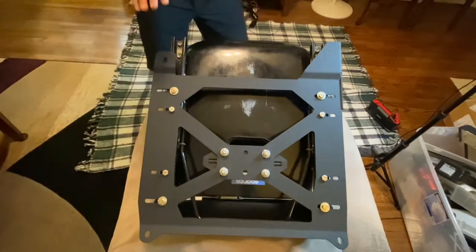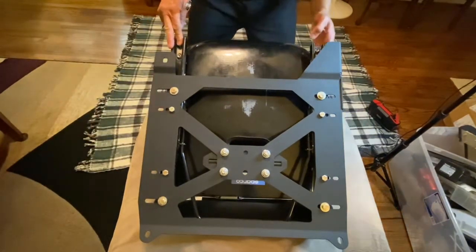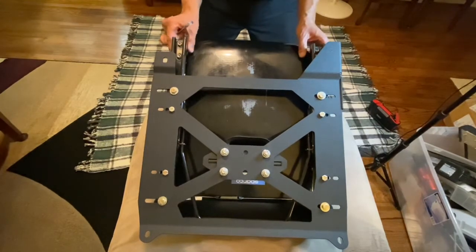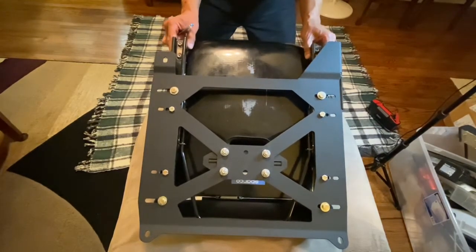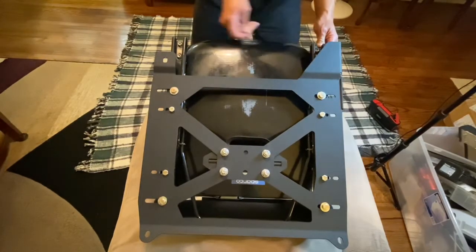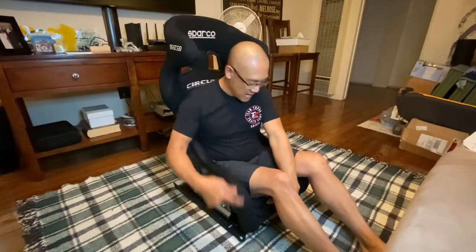But there's a spacer here, and the factory seat belt buckle bracket is right over here. So align the spacer and this bracket up real nice, and then you can tighten down the nuts right here, right here, right here, and right here. And again, 13mm. Okay, so let's check our work. I'm going to lift the lever up, and I'm going to slide the seat forward, and I'm going to slide the seat all the way back. And now we've got perfect sliding motion, and it's very smooth.